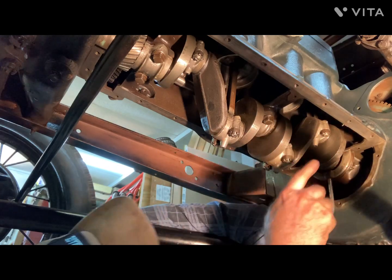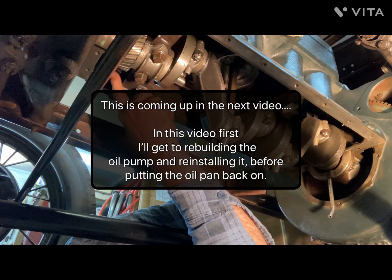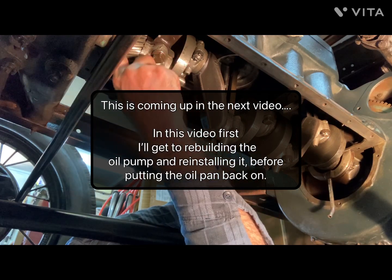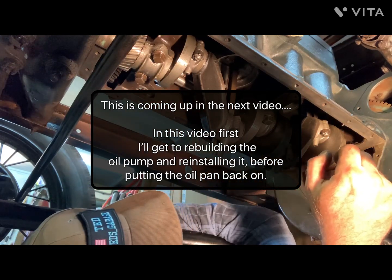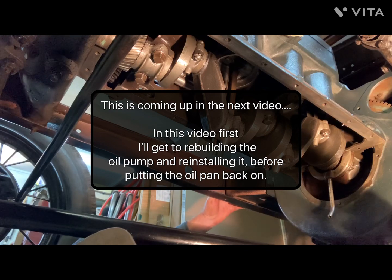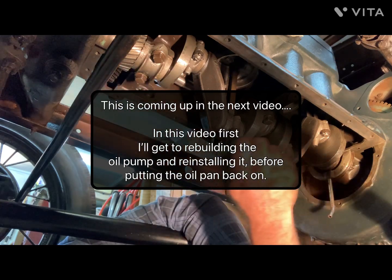I just don't want the little rust grit to get into the pan and into the oil — I'll have to change the oil several times once I get it running to flush everything out. The next step is to put the pan back on, then use the pan to support the engine. Up front I'll take the front motor mount off and access the timing gear — there are huge chunks out of the teeth, it's just rotten away. I also need to get to the front rope seal and put a new one in since it's 60 years old and brittle. I also have to disconnect the rear motor mounts so the engine can move a little bit when I put the jack under it to take the front motor mount off.